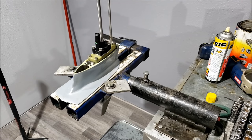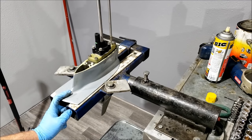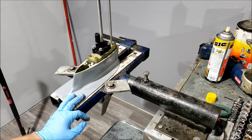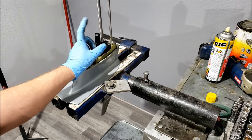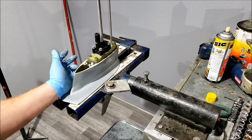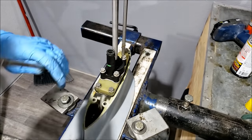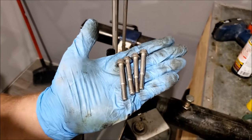After taking apart this outboard with no hours on it, I can understand why that happens to so many people. Fresh water or salt water — even worse — it's going to happen. From when they were new, you needed to take these things apart and grease everything up — I think that's the only way these engines are going to last. Unfortunately, this video is over 30 years late and the damage on these things is probably already done. If you're going to buy one of these, maybe take the propeller off, drop it lower, then buy one. The survivors still out there were probably using fresh water, maintained, and re-greased every couple of years. But if you come across one that's never really been maintained, you may have a lot of problems on your hand. No anti-seize, Loctite, gasket compound — absolutely nothing on these bolts.